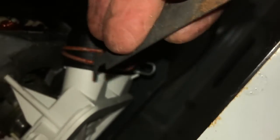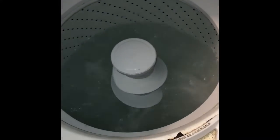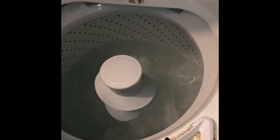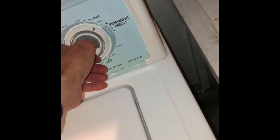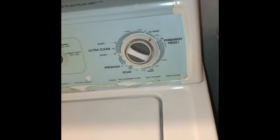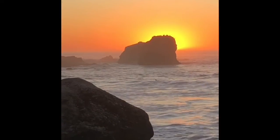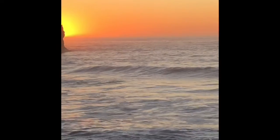Once you get the machine back in place, grab it by the back and lift it up about six inches a couple of times — that helps reset the back feet. With the new motor coupler it's back to agitating and spinning correctly again, just working great. These are really good machines and should last a long time — just try to avoid washing heavy things like blankets, bathroom mats, and comforters. Thanks so much for watching; hope this helps you fix your Whirlpool washer, and please subscribe so we can send you more videos on how to fix appliances.